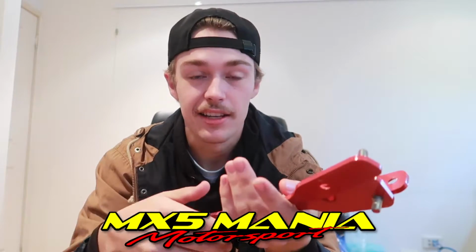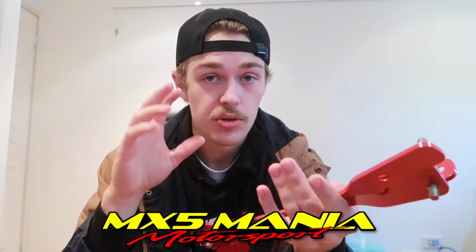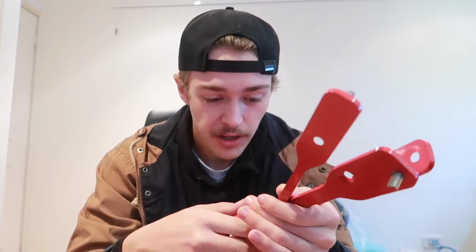I got these from MX5 Mania. They sent me these out. These are literally plug and play. You bolt these to the Sparco's bottoms, and then those mount to the stock NB and NA rails. It allows you to still run the stock rails and sliders, and it still allows the slider to work, so you can still go the full 15 clicks forward and back. And I think these might actually allow you to go a bit further back than stock.